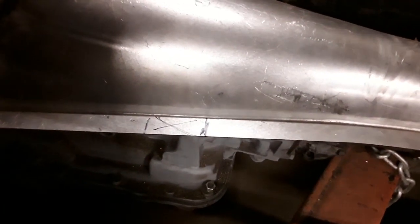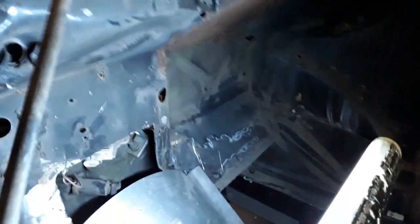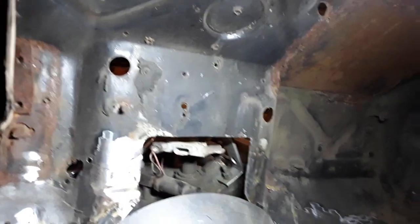So the tunnel — I've got that clamped on and everything looks pretty good. I'm fairly close to the transmission now, but the transmission is going to drop a bit when I get the driveshaft put in. I've also cleaned up the firewall, cut part of a hole for my distributor. My distributor's in there. It's an HEI, so I'm going to have to probably take out another couple inches above that and then box that in.